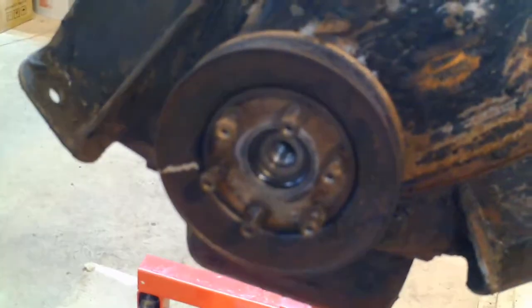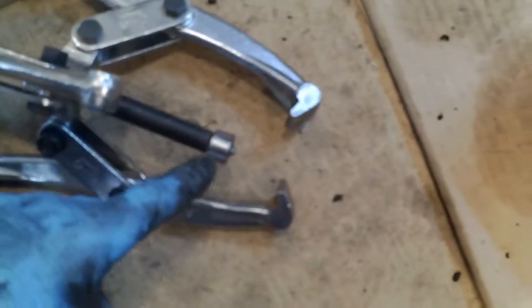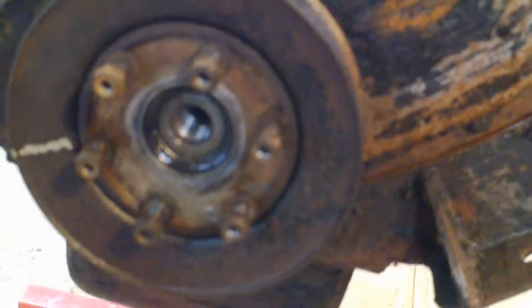I'm going to go for removing this pulley — I've got the gear puller. This doesn't fit super well into the crankshaft end here, but I'm going to put a washer in and put a little oil on both sides — probably a little overkill, but just so it doesn't mar anything up and that end piece can turn freely. The gear puller is on and this is pulling off very easily. I'm a little worried about bending up the pulley with this approach, but it's coming off. Just got to watch this tab for the timing — don't get it bent by the jaw.